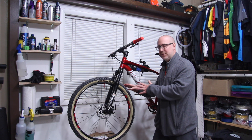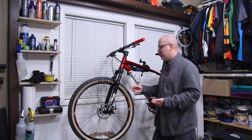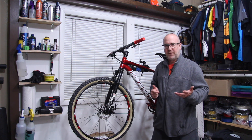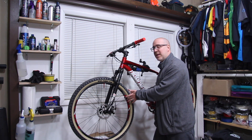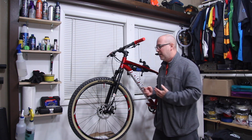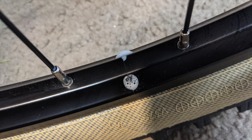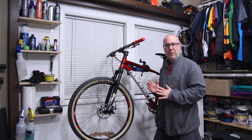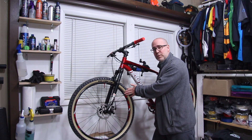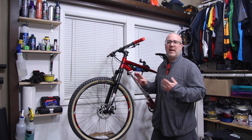That was a pain — this was not easy to do. The Vee tires look great and they're going to do a wonderful job on the trails, so it has nothing to do with the tire itself. These are tubeless ready tires and I'm sure they would snap on and work great on tubeless ready rims. But putting them on these rims required extra tape work and it wasn't fun. I had to take the tires off a couple times, add more tape, and redo it. So I would actually say this would not be an upgrade I'd recommend an entry-level person to do. Certainly upgrade your tires — the Vee tires are great — and you can use tubeless ready tires on non-tubeless rims, but keep that tube in there to make the whole process a lot easier.